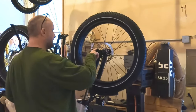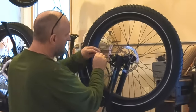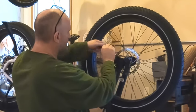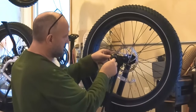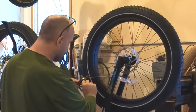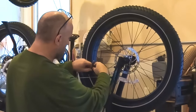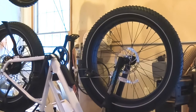To start with, we're going to take the two bolts out of the caliper and pull the caliper off out of the way. Once the bolts are loose, simply slide the caliper up off the rotor and lean it out of the way. I'm going to take the bolts out and the bracket off so they don't fall and get lost. I've got the bolts in the bracket — set that aside.